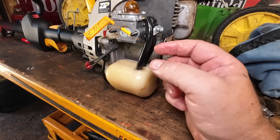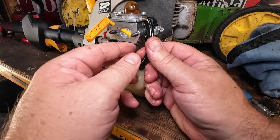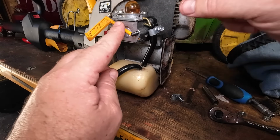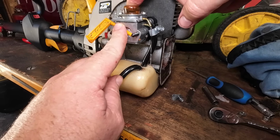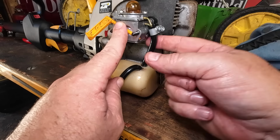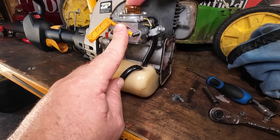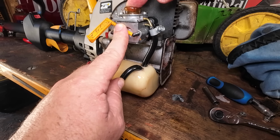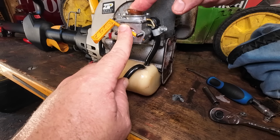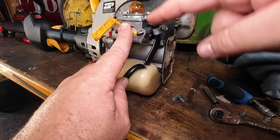Right, I just want to bring you back in because it's not right. So someone's been in here. So, well, obviously, take this pipe off, right? Now, if I prime that bulb, right, push down, I'm getting fuel coming out, which means this is your return. This one here is your return. This one here is your feed in. So the lower one you feed in, if you prime it, it's pushing fuel out. And as you suck more fuel up, it fills it, push it out again. Yeah, so that's definitely your fuel out pipe, your return, right?